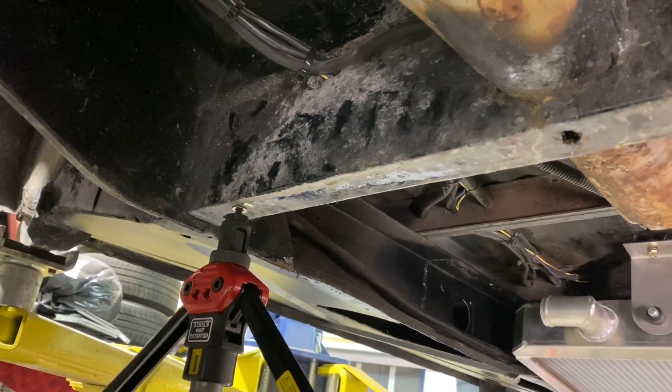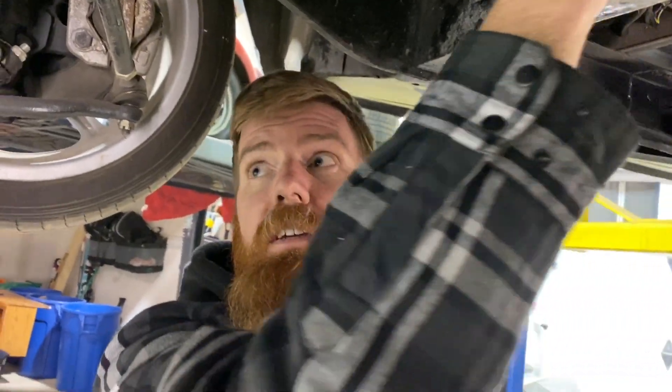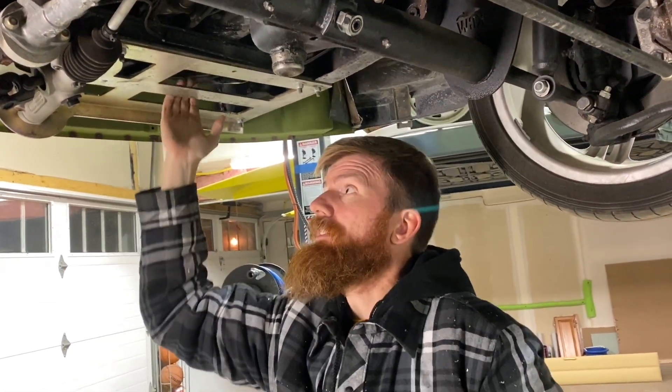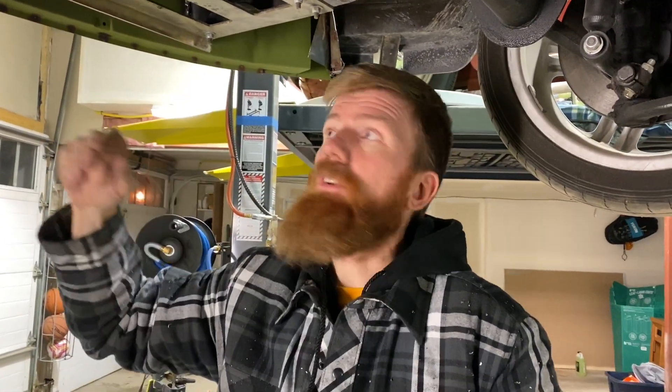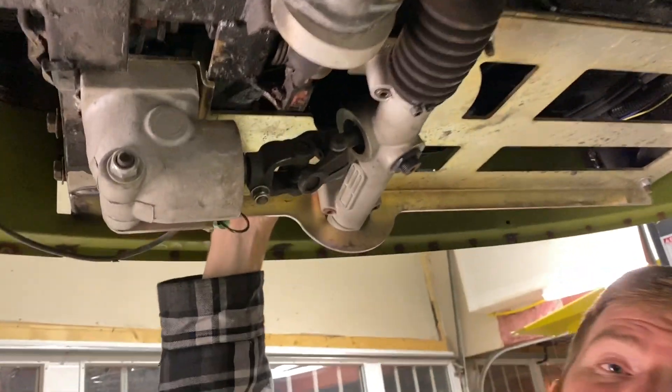It's hitting my heater tube, but because we are putting heat into this bus and this is in the way — it's going to be removed all the way up to the front elbow. I can't do that until I get my steering rack Creative Engineering half-rack kit out of the way. The heater core is going to be tucked up here nicely. That will be another video — we'll be showing adding heat, not just under the back seat. A lot of guys with Subaru swaps throw it under the back seat, but in Canada in the fall I want warm hands and face in the front.